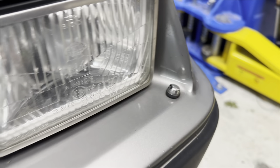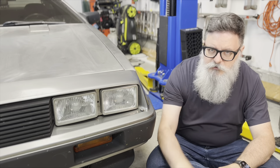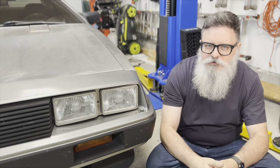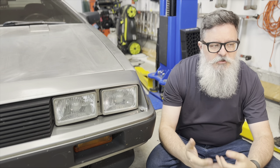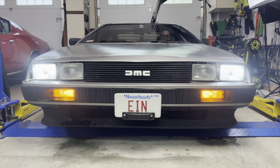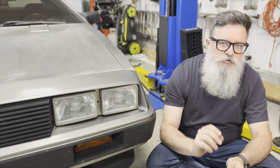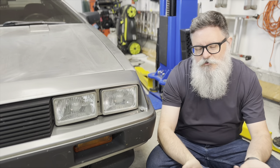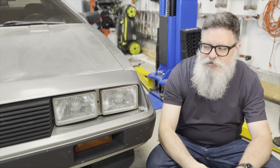A friend of mine had these Mercedes headlight washers lying around, so he helped me install them in the DeLorean. The logic is that this car is so low to the ground that these headlights get pretty dirty pretty quickly, so some washers aren't a bad thing to have. I got a generic washer pump and we fed a hose into the bottle and tapped the original pump wiring so that cleaning the windshield also cleans the headlights. My friend was able to run the hose up to the washers from under the bumper. We did have to drill two small holes into the bumper for the nozzles, so I guess I do sometimes make permanent modifications for upgrades, but I do try to minimize them. These washers are pretty subtle — few people even realize I have them in the car.